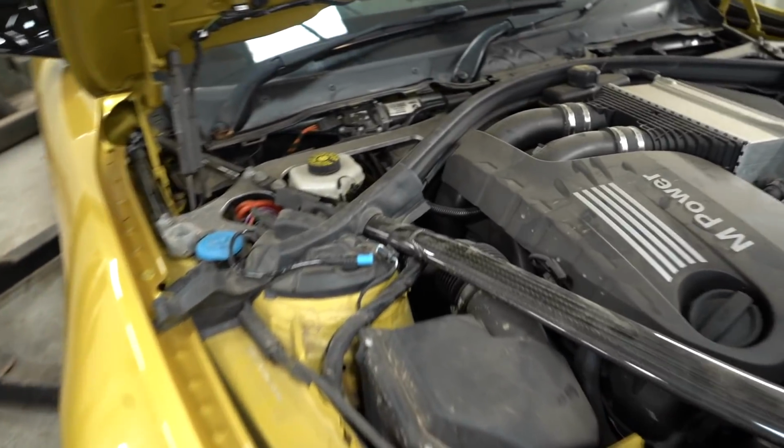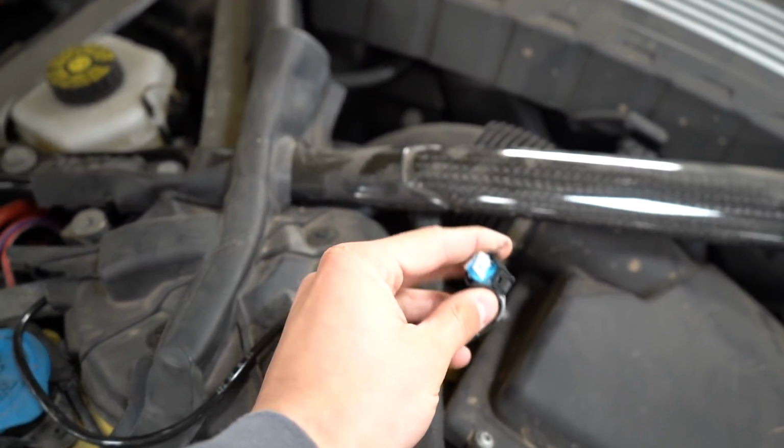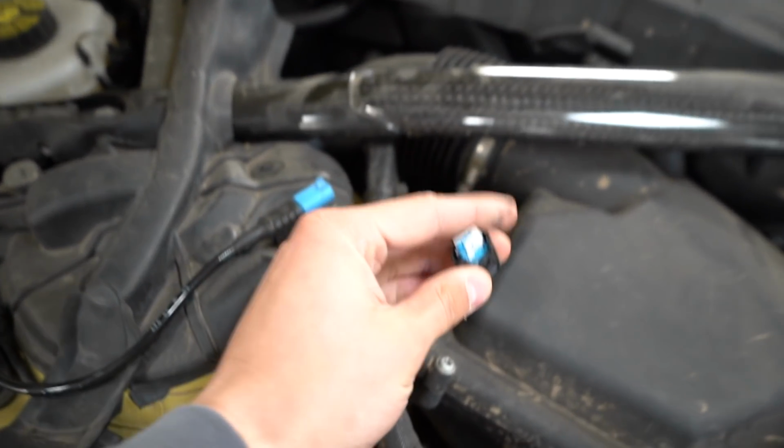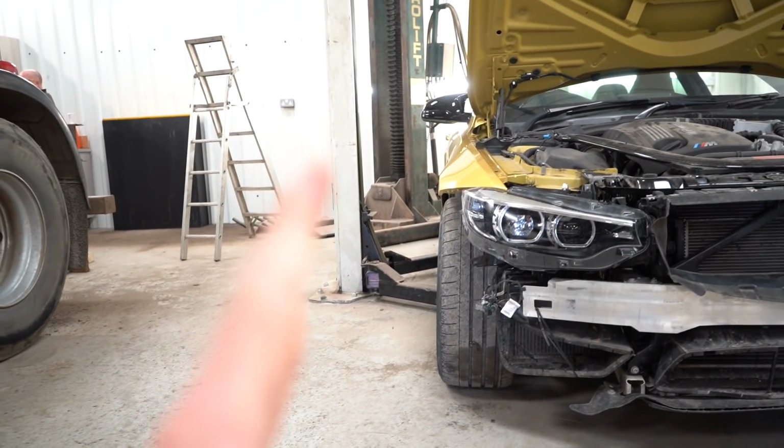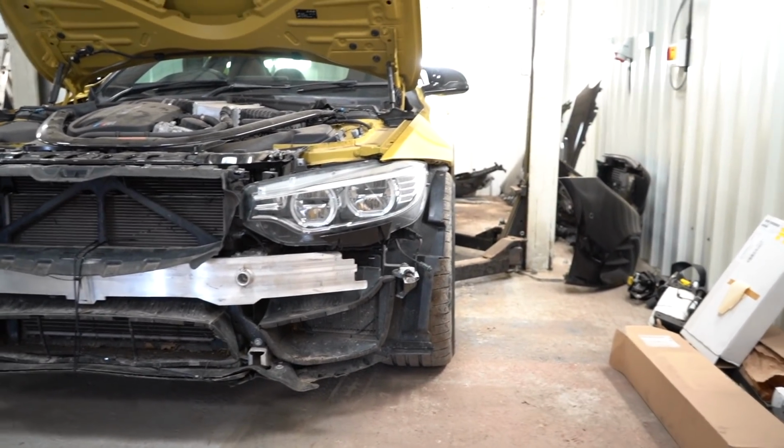There is a plug here as well, which is preventing the suspension from moving properly, and that plug's broken, look, you can see there. So we've ordered that plug as well, which should be arriving today, and we'll just solder that on, which ain't gonna be an issue. But one thing I did notice, if you look at the wheel from this side, it's sort of in a little bit like this, yeah? Come around this side, it's in a little bit as well, but it's not as bad. So when we get it on the ramps, we're gonna have to take a look at that and just check that there's no underlying issues with the suspension there or any of the arms, because I don't wanna be driving through Monaco, crabbing along. Look like a right donut.